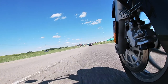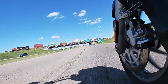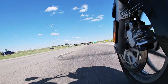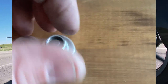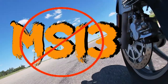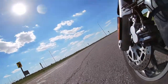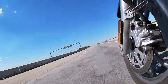Now wait. While you wait, take a look at the oil plug. There's a little magnet in the middle of that oil plug and it's normal to see a few fine metal bits in there - that's totally fine, totally normal. What you don't want to see is large chunks of metal. If you do see large chunks of metal you have a big problem and should probably bring it to the professionals. The washer on your oil plug is called a crush washer or an oil plug washer - it's made of really soft aluminum or copper. The size for this particular bike is an M14 - that's metric 14, that is the size of crush washer you're looking for as a replacement. If you can't find one you can use the old one in a bind, but I'd suggest not doing that because if it was totally crushed before, chances of it leaking are pretty good.